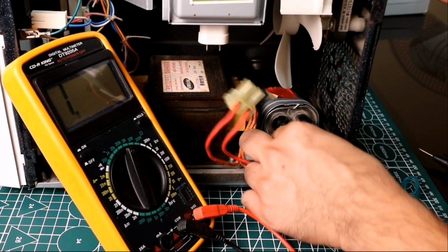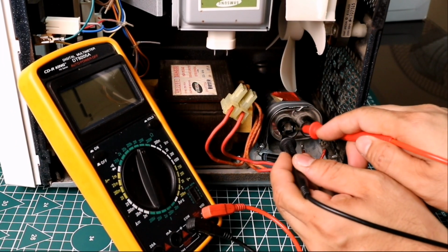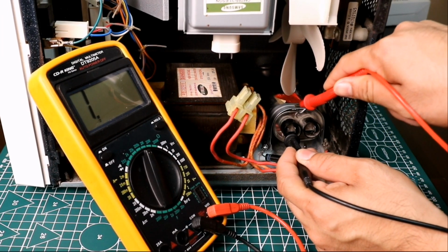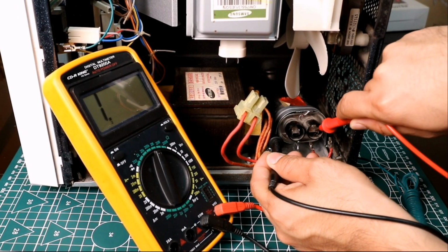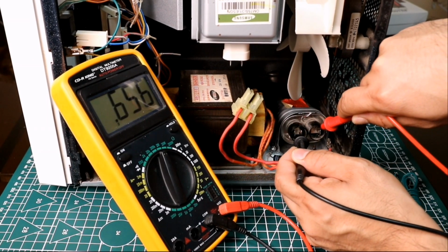Disconnect the high voltage capacitor terminals and test it using a multimeter that is set to the 2 megaohms range. You should not get any resistance reading when probing the capacitor metal case and terminals. Probe the terminals only. You should get a value that should quickly disappear because the capacitor is now charged. This effect is true even if you reverse the multimeter's test probes.